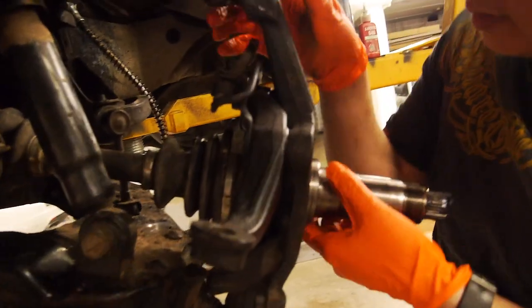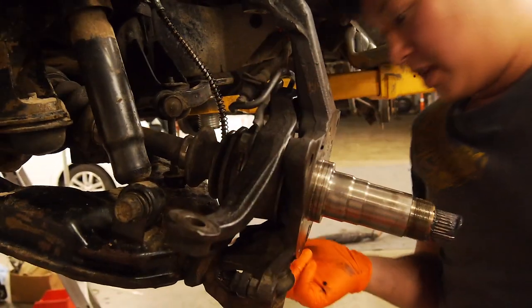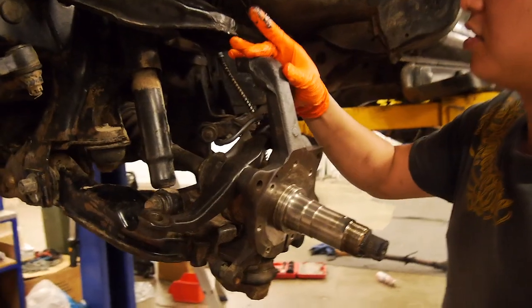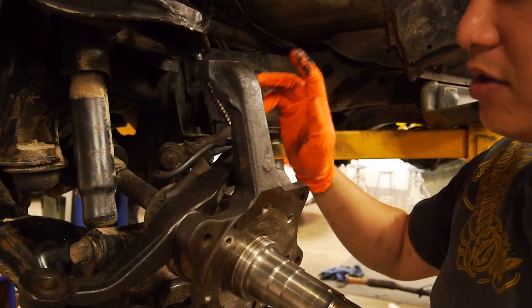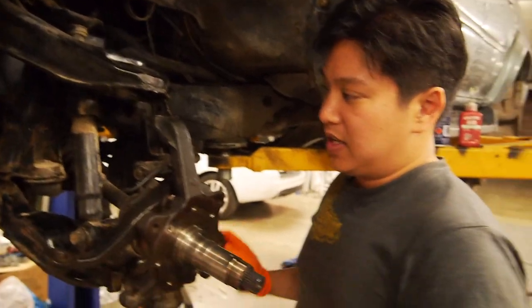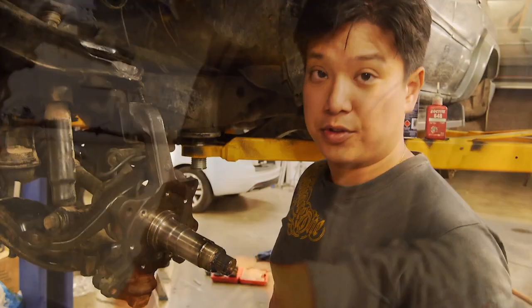Next step is we're going to put moly grease on this bronze bush — on the thrust surface here and into that groove. They're both lithium complex base greases, so they're perfectly compatible. If you're using different greases, make sure that they're the same base and that they're miscible. Also on the bronze bush on the front. So that's all sorted — I'm going to line that up, do that little wiggle and then come down and place it on the knuckle. So that's all sorted in there now, and we'll run the bolts in through the bottom so it's all secured.